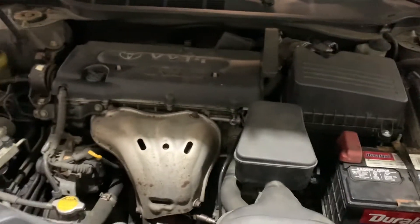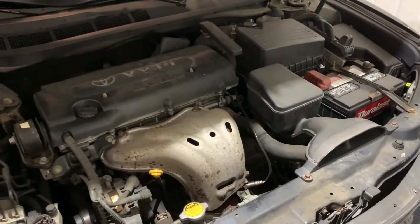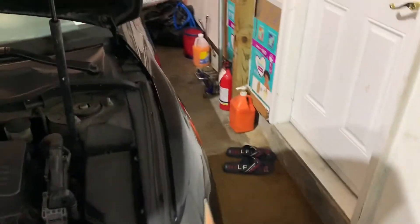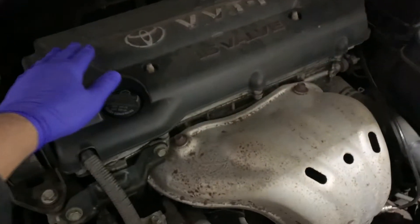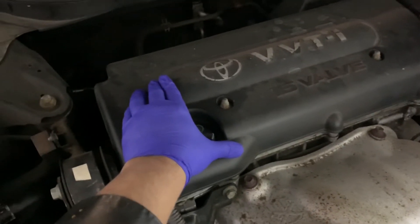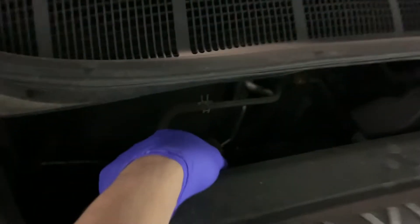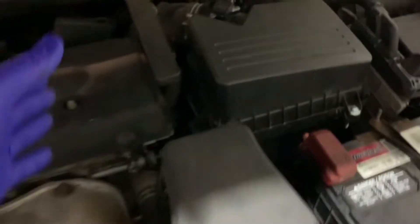I got the car inside my garage now. We're going to open up the hood and see if it's a PCV valve issue or oxygen sensor issue, or it could be related to something else — could be a fuel filter. The fuel filter is actually up in the tank, which you can access by removing the passenger seat in the back. First, we're going to do a couple of tests. The PCV valve on this 2008 Camry 2.4 is mounted right up here. As soon as I remove this cover, it should be right here, and the hose is connected right behind it.